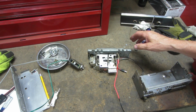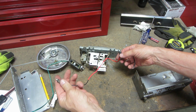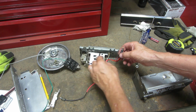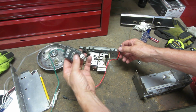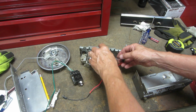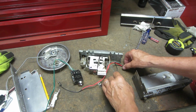All right, we're all done with wiring. So what I did was wired in the power plug here. One end goes to a fuse that's already existing in the truck that the radio was using. The other one goes to this power plug. And I wired in the light there. I looked forever on this thing. I can't find a hot just when the switch is on. So the compromise here is when the key is on, the light will be on for this. I don't have it tied to the switch, but that's okay, I just wanted to do that.